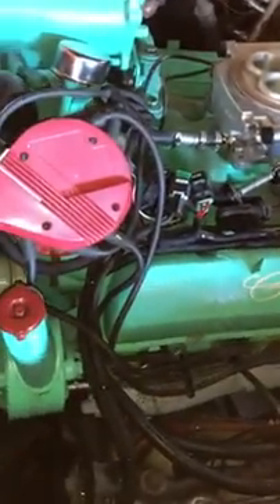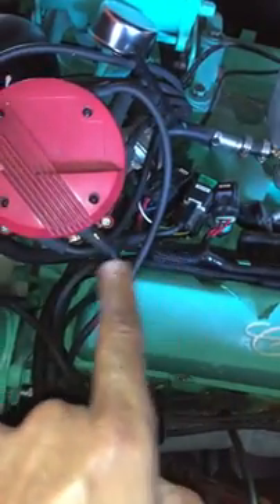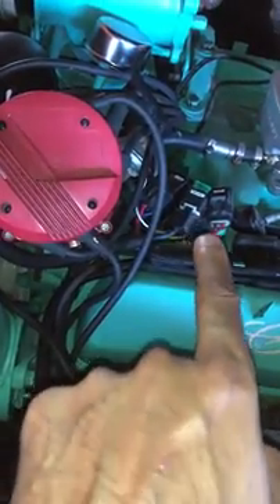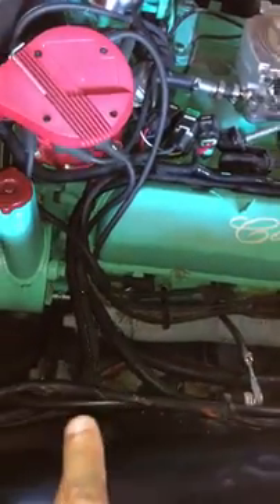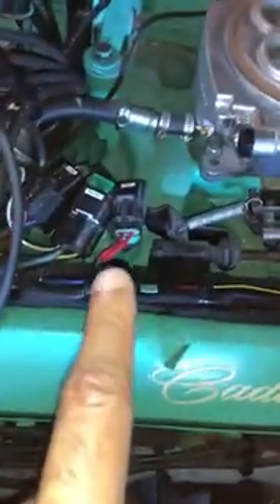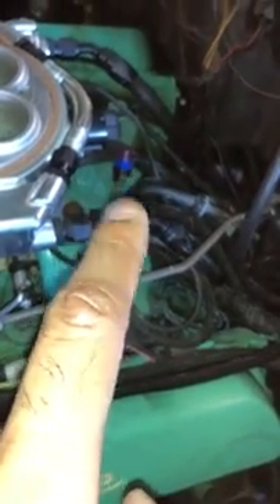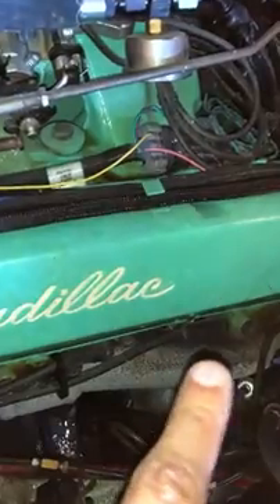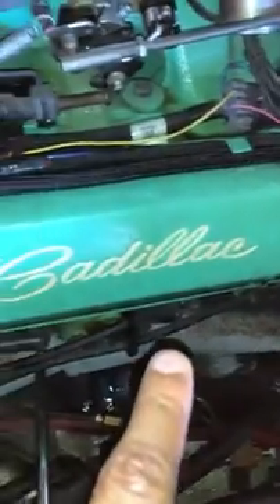Here's my wiring again. I've got my distributor, my coil is in there, and the wiring for the ECU. Really, the only thing that comes over here is my power wire for the ECU — it goes up to my battery. The rest of everything goes back to the main harness, up to the IAC. My plug wires are all down below my valve cover, way down by the header.